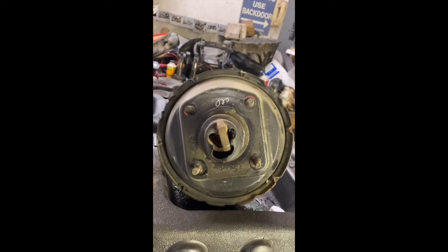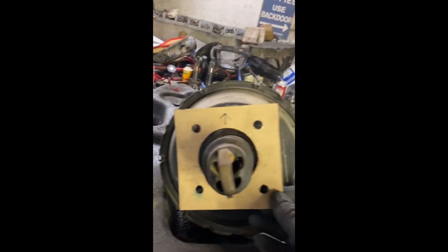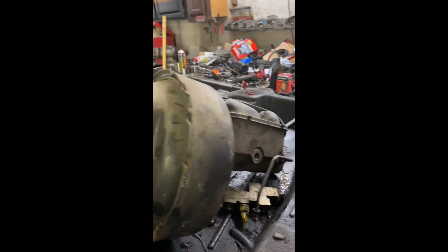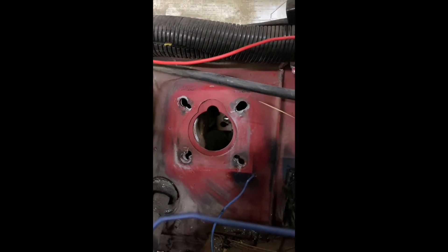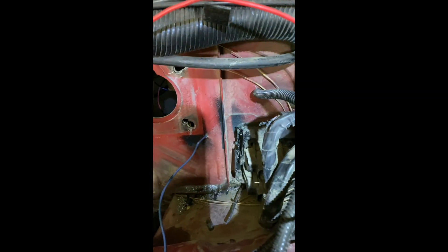So the bolt pattern for our old 92 master booster is substantially different than the one for the new JK. I didn't go ahead and take measurements — I just made a template. Basically what we did is we made a template off the new master booster. You can see the modifications are smaller; it still fits, but you have to egg out the holes to get it to line up. Once you do, you have to modify the pinch seam at the top just by making a slit on both sides, then folding it up. You also have to modify the power block just a little so you can get clearance, rounding that corner off to make room for the edge of the diaphragm.